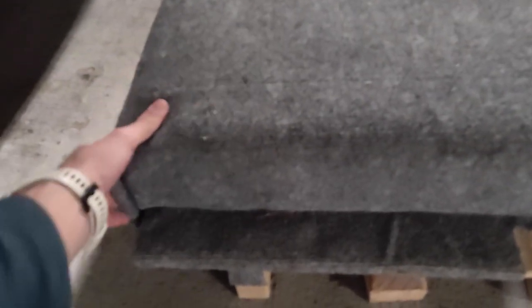In terms of construction, this is the footrest — this side goes towards the front of the car and this goes to the trunk. For the most part it's built out of half-inch ply, carpeted with staples, with a hole for a single drop bolt. The carpeting is just something that was for sale at Home Depot. Underneath, there are two hinged legs that are 2x3s — a little bent but they do the trick with some really simple hinges. This cross piece is just a 2x3 drilled down at an angle, and it rests on the seats where they're folded down while the legs rest on the floor behind the driver's seat.